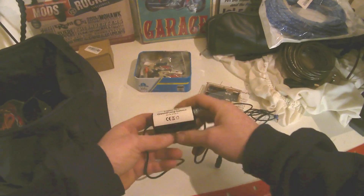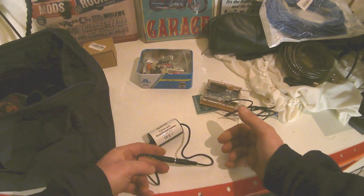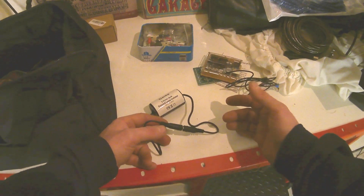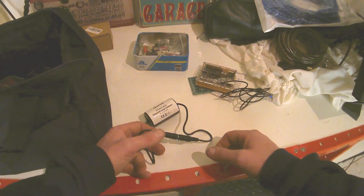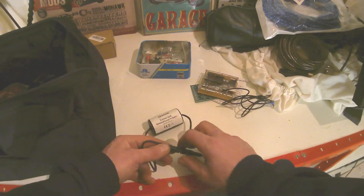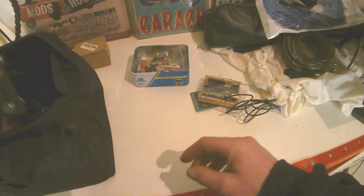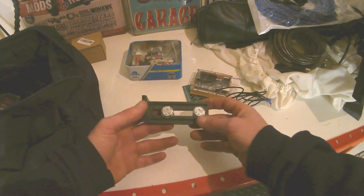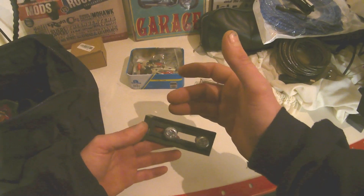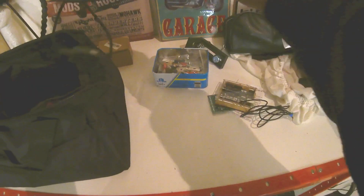Here it is - this is an audio jack cable ground loop isolator. Basically this is to try and eliminate any background noise or interference that the RPM sensor is getting. When we plugged it in before, it was fine on one bike, then we plugged Mike's in and it was throwing the signal all over the place on the dyno. Hopefully with this fitted we'll be able to get rid of all the background noise. The bracket on the dyno was made from scrap hard PVC plastic - I thought plastic would be the best way to eliminate background noise.